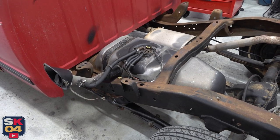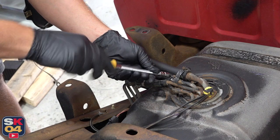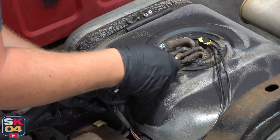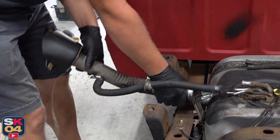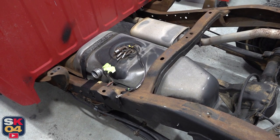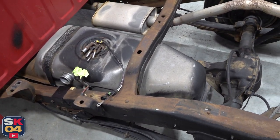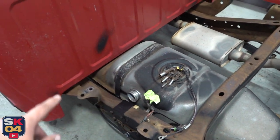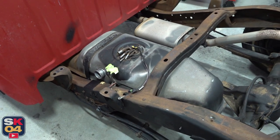What's here can be easily cleaned and repainted, so everything's going to look fantastic when it's time to get all this back together. Next up, I'll start taking all of this apart. First things first, I'm going to get all these old hoses off so I can run down to O'Reilly and pick up a new set. The hoses, filler neck, electrical, and ground are all disconnected — now I can start dropping the tank. Thankfully, there's not a lot of gas in there, otherwise you'll probably have to siphon it out. It's strapped in back here and up front there. There's a plastic guard right in front that has to be taken off as well, so it's just a matter of undoing a bunch of bolts and carefully dropping it.